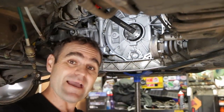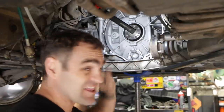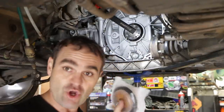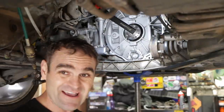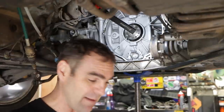All right, that came out — it took a little bit of effort but wasn't too bad. Now I've got it out, I've got to go around and clean everything thoroughly with a lint-free cloth. I want to make sure it is perfectly clean. It's recommended not to use any sealant of any kind on this seal — you just want to put it in dry and it will seal itself. But you've got to make sure you don't touch the outside of it or mess it up.